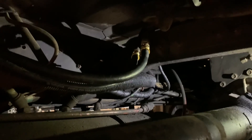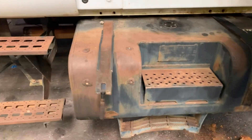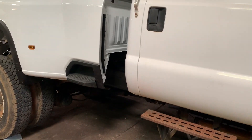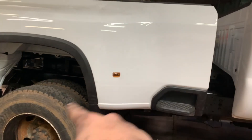Got the new lines laid up — going to clean those up and fasten them. There's no way to disconnect those lines without getting soaked in diesel, but that's just part of the fun. The old tank is free and I can just drag it out now. I might go ahead and crank up the truck because there's going to be an air pocket in there. I think I'll just crank it up and pray it runs long enough to purge the air out so I don't have to bleed it again. The new tank is plumbed and vented — still got to throw the filler neck on but it should be good to go.